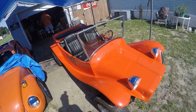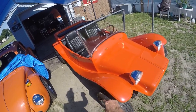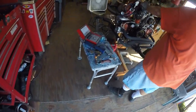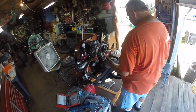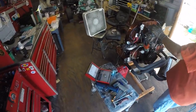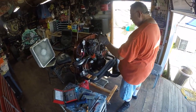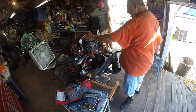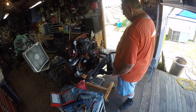If you're wondering why the dune buggy's back — it made it past its thousand miles. We had to dump the oil and readjust the valves, and we're going to retune it again. We've only got about five minutes left on the break-in — it's tuning up nicely. I'd like to lose about a hundred RPMs on the idle but we're not done yet. Timing is a little up but temperatures are fine; looks like we corrected it with the new exhaust.